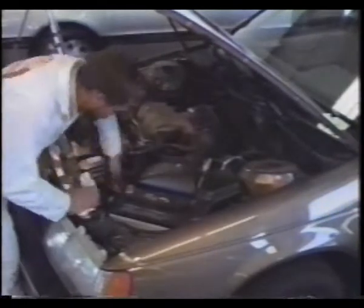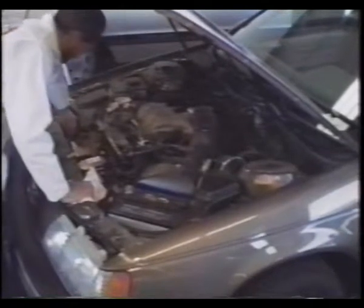Step 1. Start connection with a cold engine. Using the radiator drain plug, drain the coolant into a clean container to a point just below the level of the top radiator hose. This will prevent the loss of antifreeze during hookup of the analyzer. Check condition of the coolant in the container. If it is milky in color or excessively dirty or rusty, flush the system prior to testing. Failure to do so could cause damage to or malfunction of the analyzer.